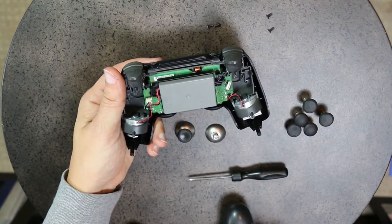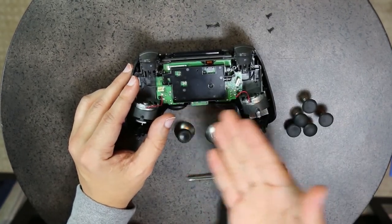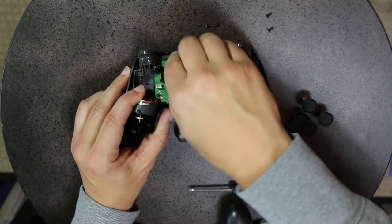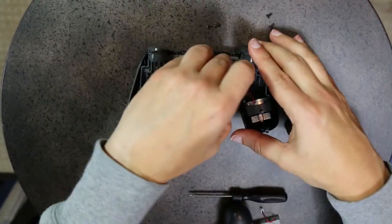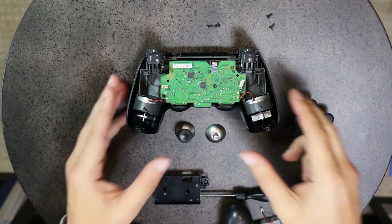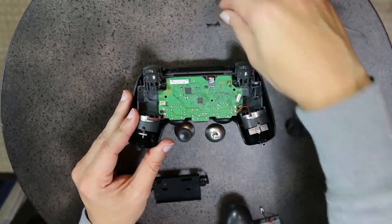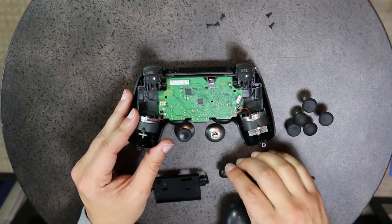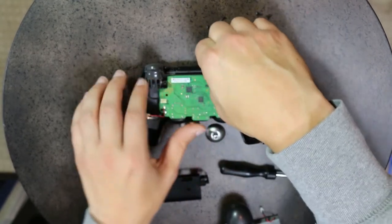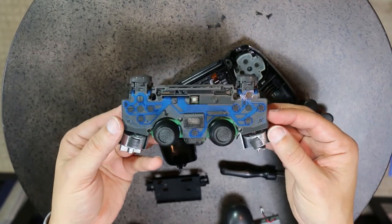You're now exposing the motherboard with the battery. Take out the battery. The battery is removed and you're left with the battery carrier and the motherboard. Remove the battery carrier by pulling the side. Here is the motherboard exposed. There are five screws total; here is the last screw, which holds the motherboard in place.